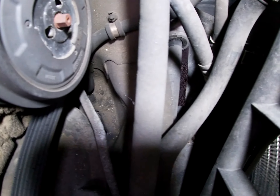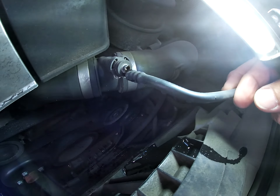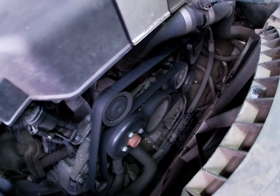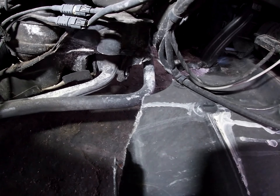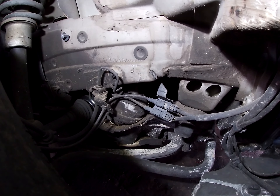Let's get to the bad news on the car. As further inspection — let me show you what's going on. Oh man, are you serious? I just broke that right there. Anyways, the subframe is bent all the way in. The only reason why I didn't catch it — look how far bent it back — it broke the bracket for the sway bar, and the sway bar is bent. Yeah, and the frame is kinked right about here. So I'm going to have to take it to my friend's shop, to the frame machine. That's why the hood doesn't close.